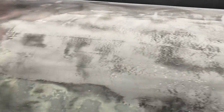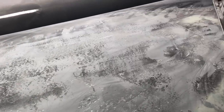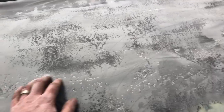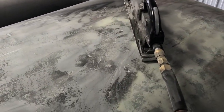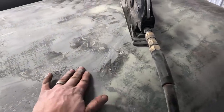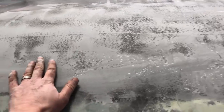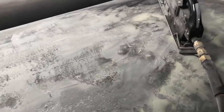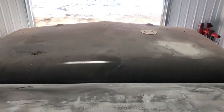When you think it's looking really nice and you're almost done, throw down a different color of primer as a guide coat — it'll tell you all the spots you haven't hit yet and show all your highs and lows. I'll keep working on this, trying to knock it down. I'll get it as close as I can, then put a thin coat of filler in there, sand that down again — rinse and repeat. Then this roof cap should almost be ready for some primer, and then on to the cab roof cap.